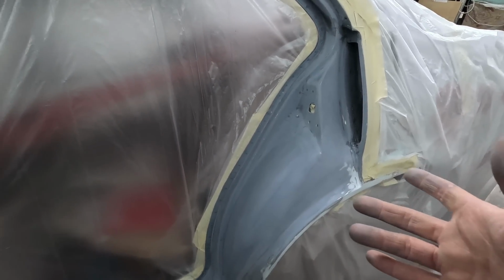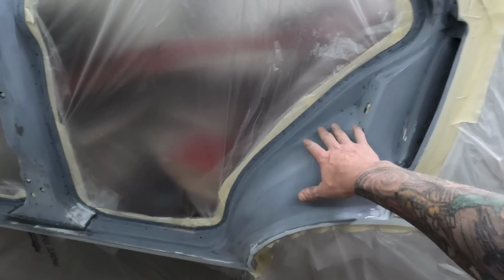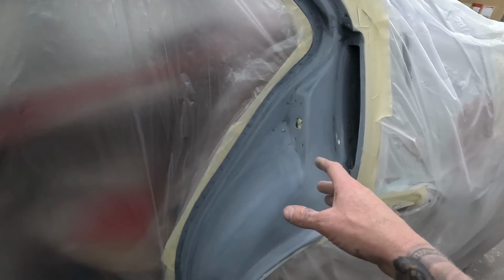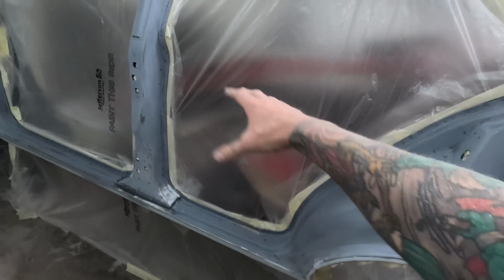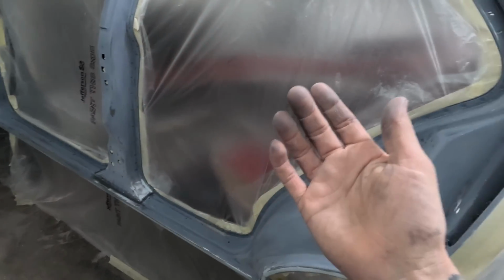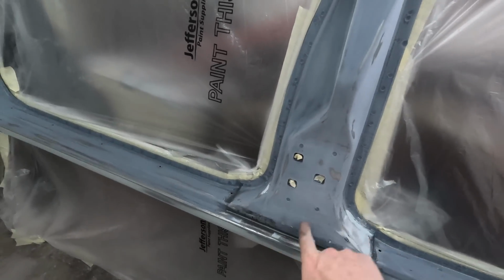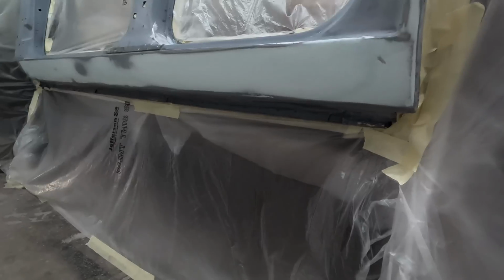But yeah, look, what you can do, and I probably should have done it in hindsight, is recoat it with any urethane primer, because that's so much easier to sand. It was hard as a rock to sand, and because of all the intricate angles and stuff like that, and the runs, I had to get bits of 120 or even 80 grit on some certain spots, because it was all running down here. It was just an absolute nightmare to work with that stuff. But either way, you know, life is a learning experience, isn't it?